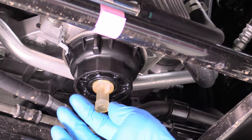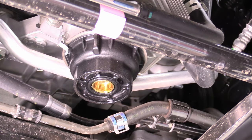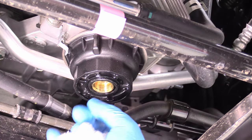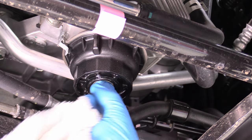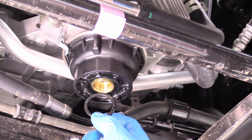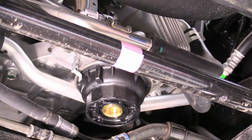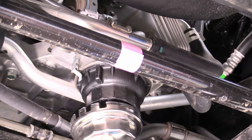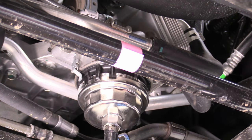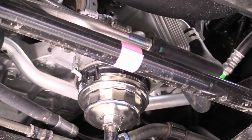Once the oil is done flowing we can go ahead and remove the little plastic apparatus. Wipe it off so it doesn't drip on us while we're working. The o-ring came out too — grab that o-ring and get it out of there; you can throw that away. To remove this oil filter housing you need a special socket — it's the best way so you don't ruin the filter housing. Make sure it's on correctly and fully seated. I'll have a link in the description to this socket. Then turn it to the left, have your oil catch ready, and the housing should come off with minimal drippage.